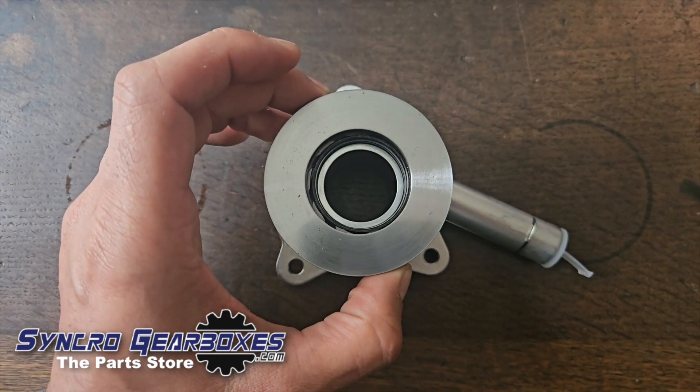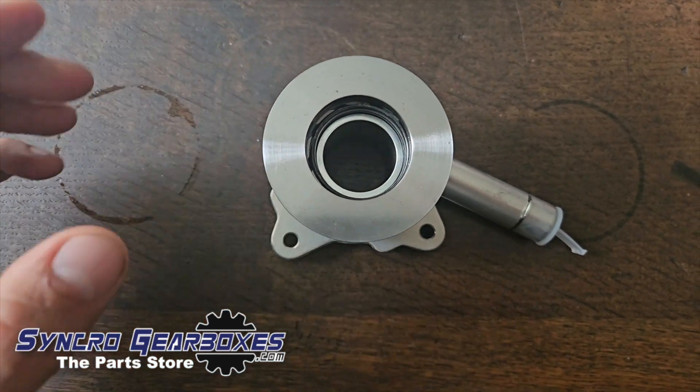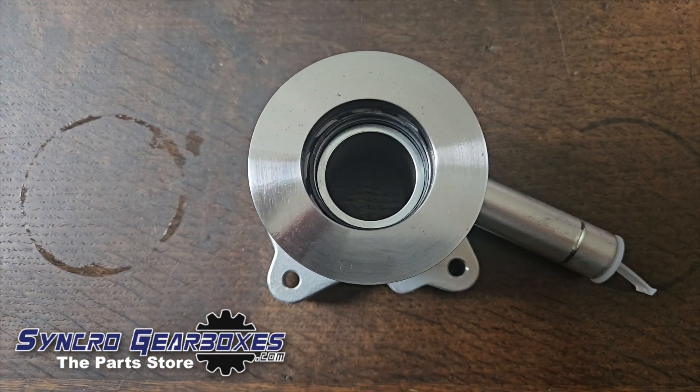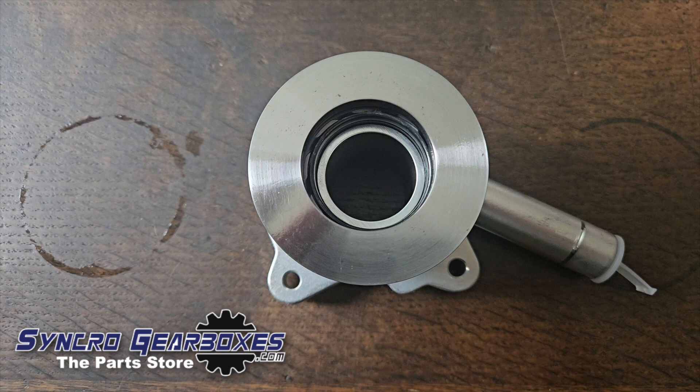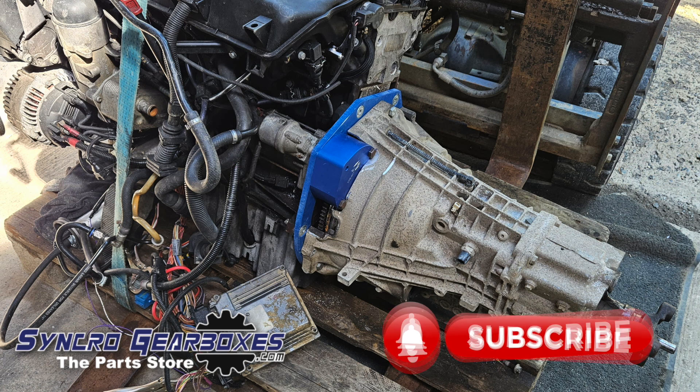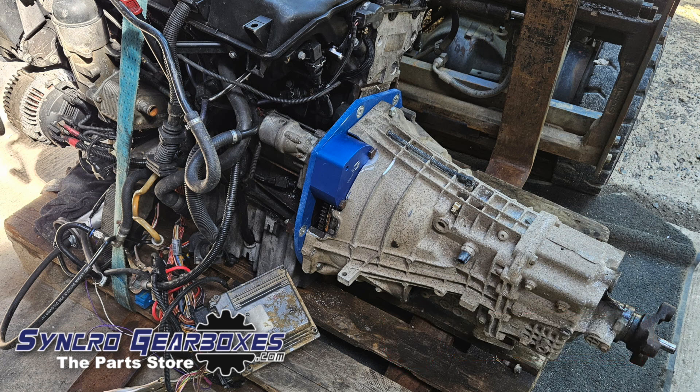The clutch slave bearing shim is only for six-speed MT82 gearboxes with the concentric slave cylinder — if yours is a manual clutch type, skip this step. It just drops over the end of the slave cylinder. Then fit the gearbox dowels back in, offer the gearbox up, put on all the bolts and tighten them down. You can weld on the starter motor cover or run sealant over it, and knock up covers for the old starter motor hole and crank sensor hole.